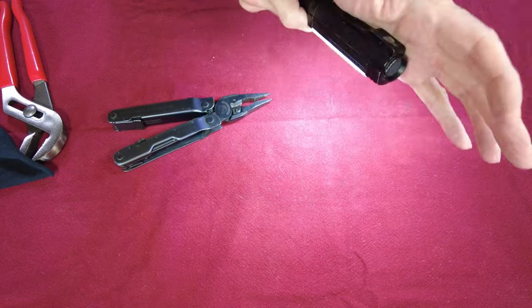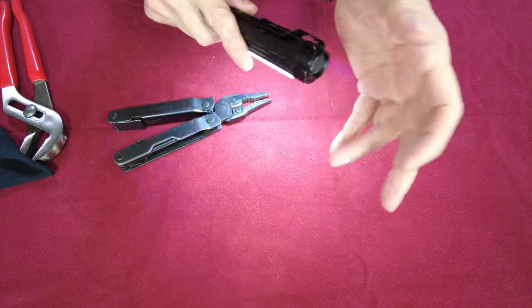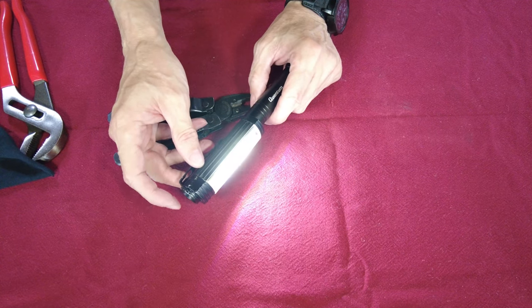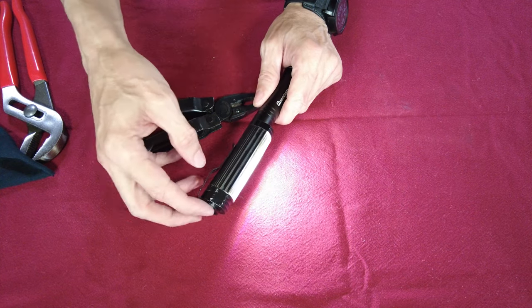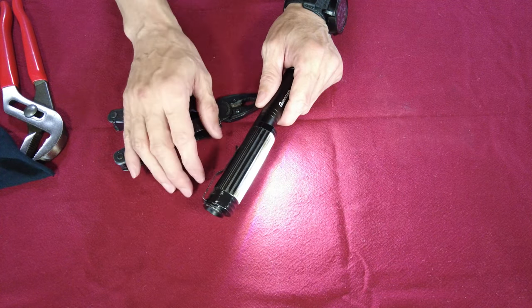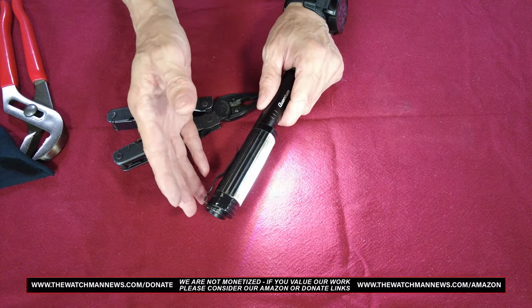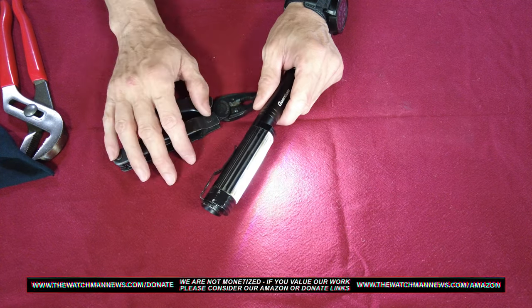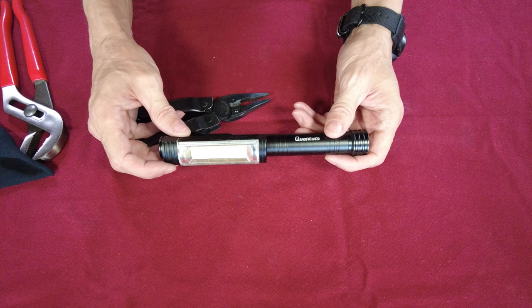Throw your batteries back in — and hopefully I didn't sabotage myself. I did not! So if you've got an issue with one of these cheap little lights, yank it apart, take that spring, and at the top end bend it out a little bit so it makes contact with the outer housing and can't move around. That spring is either losing contact or shorting against the positive — either way, that is how you fix it. Hopefully this helped you fix yours. Shalom!